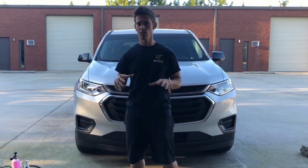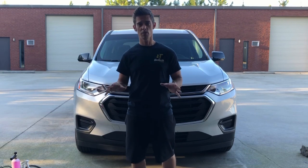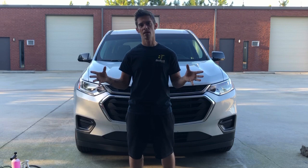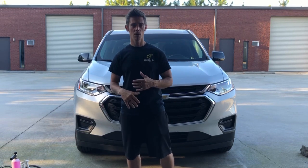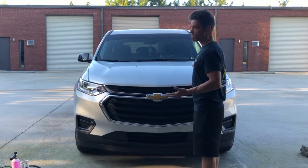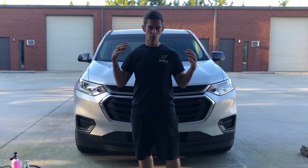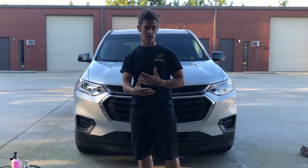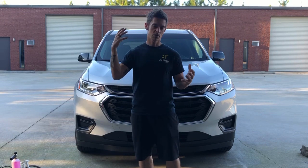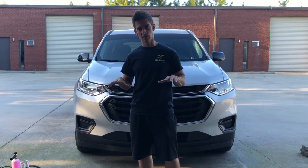It's a very, very key tip here, especially if you live in Florida or anywhere where it's warm: do not do this in the middle of the day. Do this very, very early morning, 7, 8 a.m. before it gets too hot, or, you know, right now when I'm doing it, which is about 5:45, 6 o'clock. You don't want the car hot, okay? Heat is a catalyst that will accelerate the reaction, so it can cause the soap to stick or give you water spotting or activate nasty things that are on the car. So the cooler the car, the more relaxed the paint is, the better.